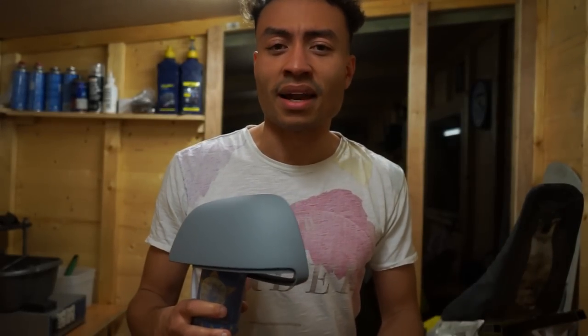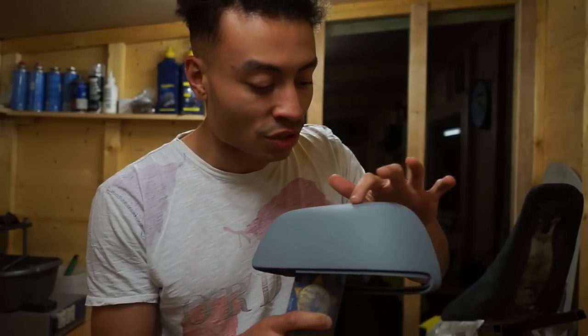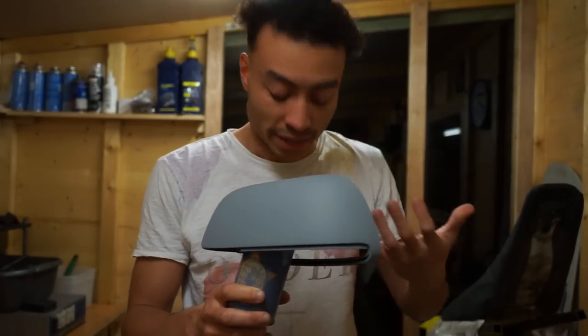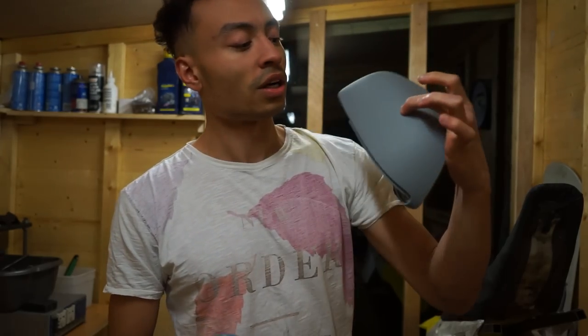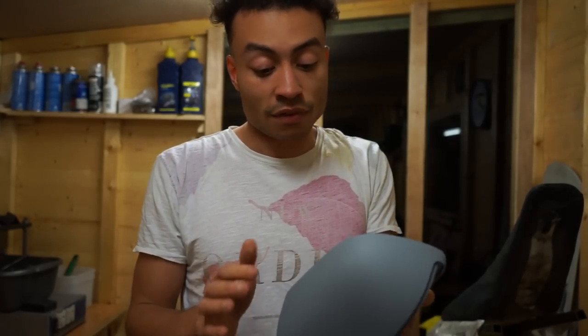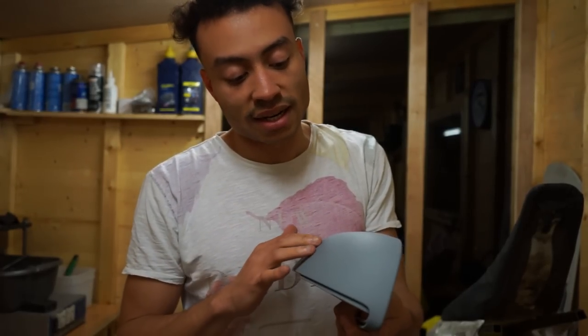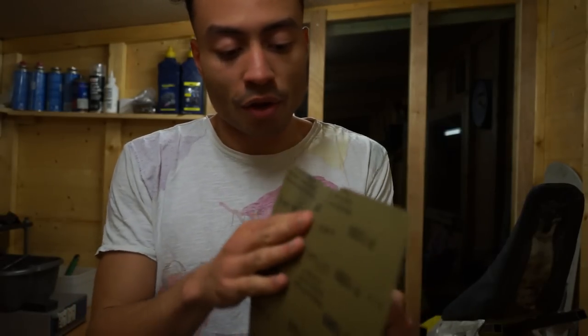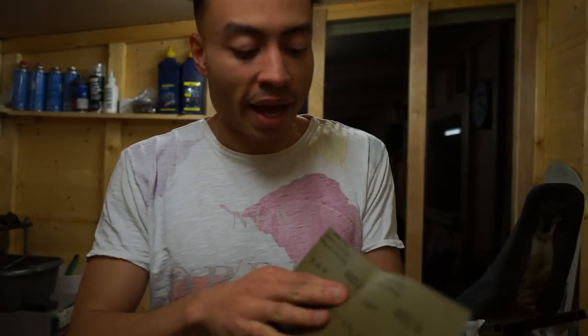It's almost eight hours later. I didn't really need to wait that long, but the Halfords primer says wait 24 hours and online it says wait 45 minutes. I decided to wait eight hours because it gave me time to do some other stuff and work on the car in other ways, making sure the primer was nice and dry — and it is very much dry. I left the heater on to make sure it stayed warm so it never got too cold to dry. It is dry to the touch in every possible way. One thing you'll notice at this stage is that it's actually quite abrasive — there are clearly some faults in the paint. What we do now is get an even finer sandpaper and sand back over it to get it prepared for our layers of paint. I'm going to go for 1,200 grit, which is super fine — it won't do too much but will make sure everything is smooth and ready for painting.